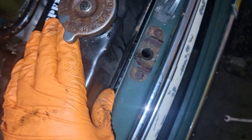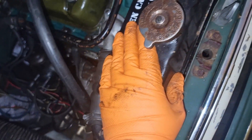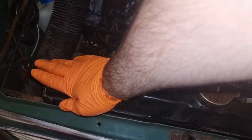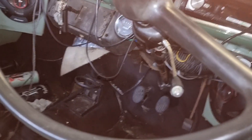It was still creeping up. You can see that's hot — steam's just boiling off some of the water that spilled. That's hot but that's cold, very cold, starting to get warm there a bit. It's stuck, actually stuck. I wonder if I turn it back on it'll start cooling down. I should maybe suggest it is the sender unit — that's getting very hot now. The sender unit seems to have stopped just before the H.